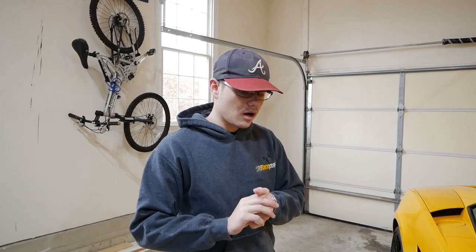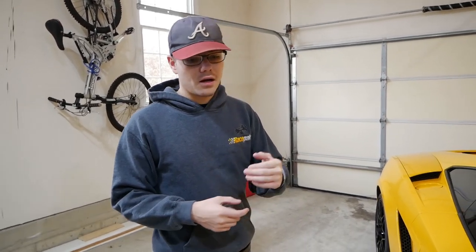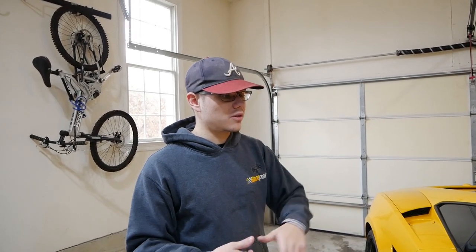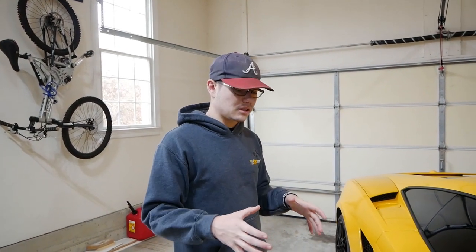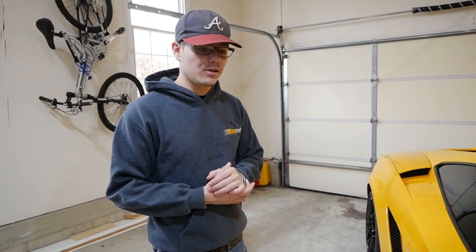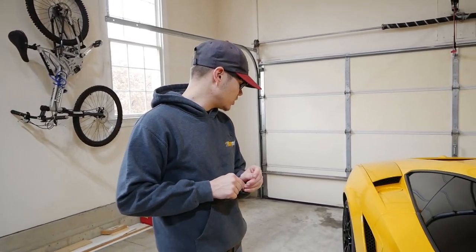The prep work — those first stages of decontamination including the wheels — are actually pretty quick, probably just a couple of hours to correctly do it. Paint correction is where a lot of your time is at, whether you're doing paint protection film or ceramic coating or in this case both. On a car like this that's minimally swirled, probably six to eight hours worth, maybe a little more or less. It's all in the prep work. The PPF does take some time — the hood may take 30 minutes to get all lined up, then five to ten minutes to tack it down, roll edges, and heat-seal any edges that have issues. But the ceramic coating itself doesn't take long. You can ceramic coat a whole vehicle in three to four hours with two people. I'm guessing there's going to be roughly 30 to 35 man hours in this entire job.